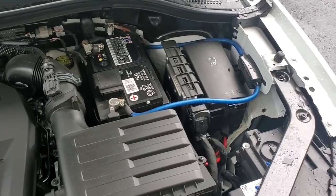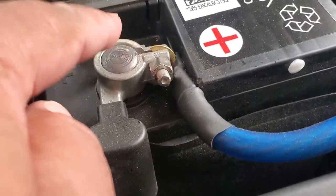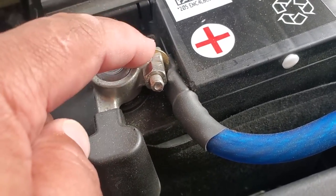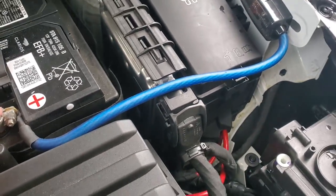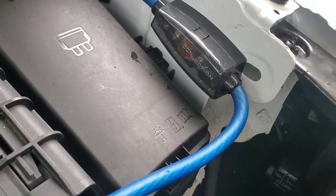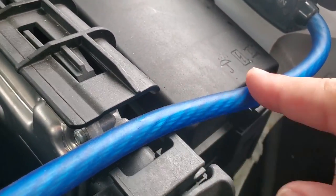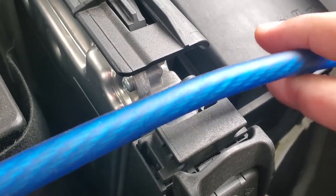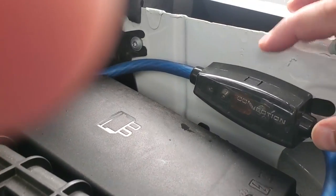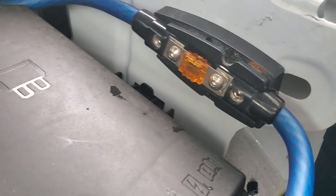Something really simple and very important — I used four-gauge wire. I did an o-ring, completely took the bolt off, put the ring in the middle of it, and squeezed it back down tight. You need a fuse typically less than about 12 inches away from the battery, because theoretically if any of this wire shorted against metal it would pop the fuse first. This area needs to be as short as possible since it's not protected. In an engine bay it should probably be wire-loomed. It's a simple blade fuse — very easy to replace, but on a basic system like this you should never pop a fuse.